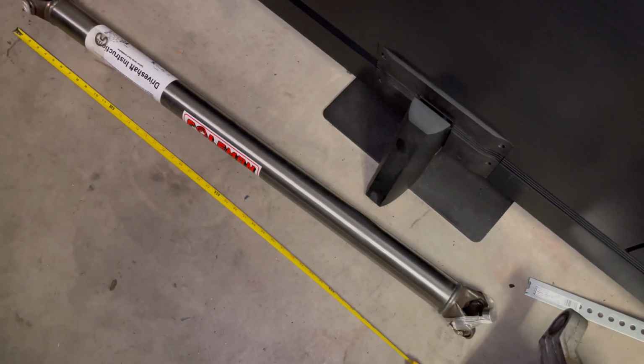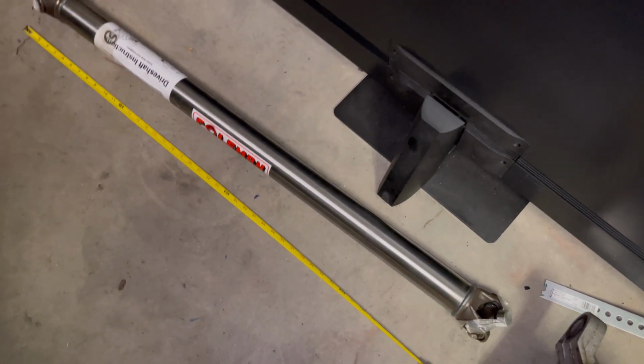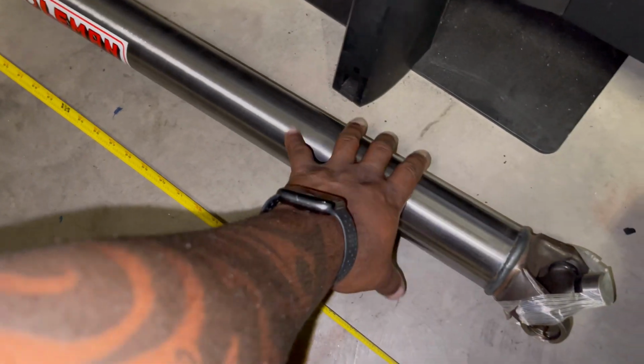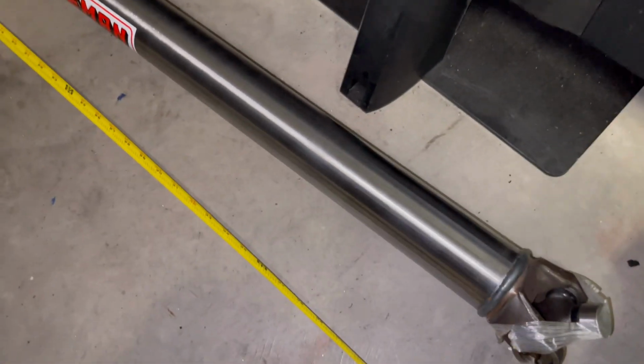So if you go with aluminum like I always do, there's always more harmonics, more vibrations, just transmitted, okay? And when I went steel on the Z32, I had none of that, okay? So I wanted to stay with steel. That's just my preference. I'm gonna pull out a scale once I put this together, show you guys how heavy it is. Cause you know, aluminum is really light.